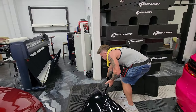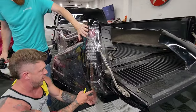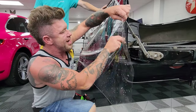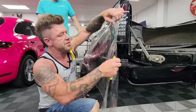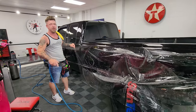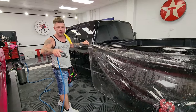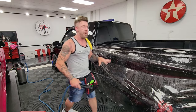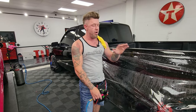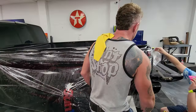This just got painted, so to avoid seams and to make it look flawlessly seamless like we like to do, Dakota had the idea of removing the flare. Right now I'm trying to find where the end of the film is going to stop. There aren't a lot of pre-cut patterns for '98 dually trucks — this is all experience. This is a big piece of paint protection film, what we call a bulk piece because there are no patterns. Typically when you cut PPF for cars, you use pre-cut patterns run through a machine. We're making it custom on the car — a lot harder, more intricate, more chance to mess up and waste material.